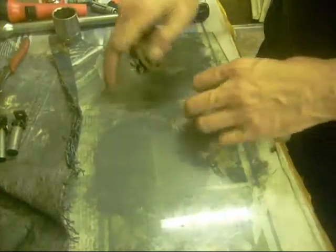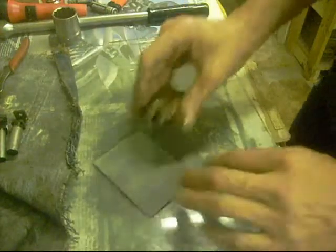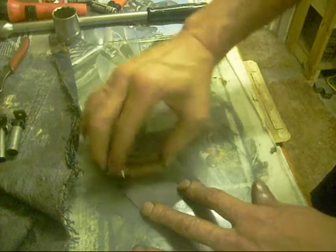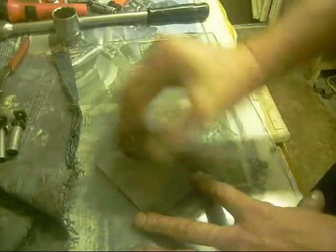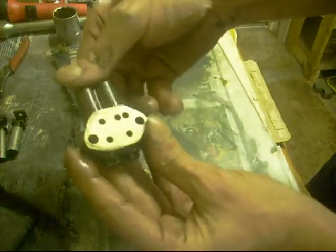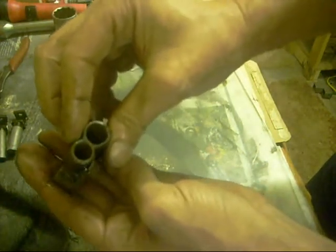I've got a piece of glass and some used 600 grit — just carefully do that. It's really just to make sure the face is flat and to get the old gasket off. There you go, that won't leak. Give it a bit of a washout with petrol, fill it with oil, and clag it on.